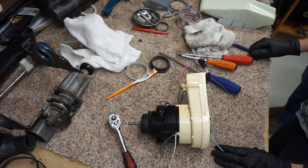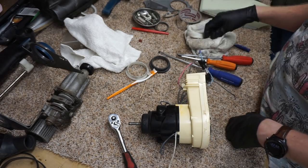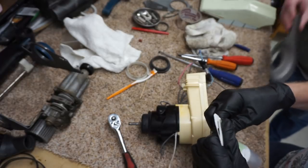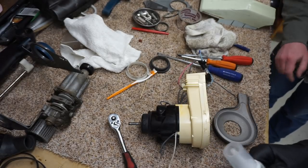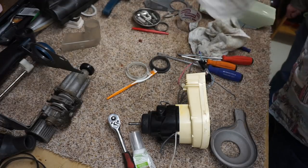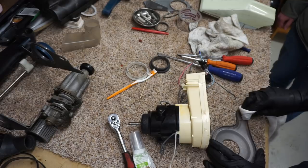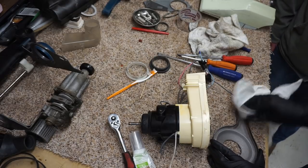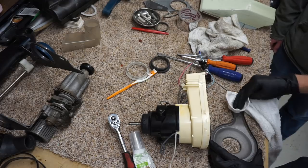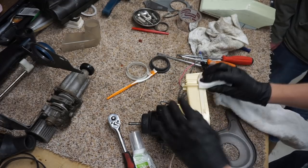I think we will. My silicone, the tube here? Yeah. Glue. So this is silicone premium glue. I would put that bead on here. Yeah, that's where it's going to go, around there. We're going to clean around there with alcohol, a prepared surface, just to make sure, because there's some rust on this from the years. We want it sticking to metal, not loose rust.